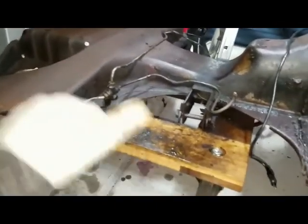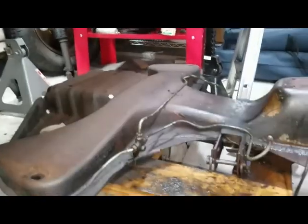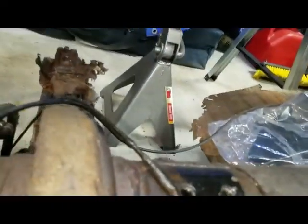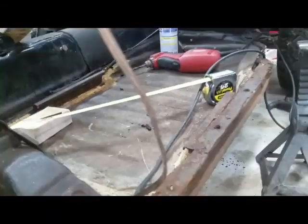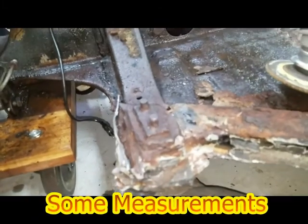I'm going to clean up this area — I think it's a little rusty but the metal is real solid. I'll clean that up and refinish it. But I'm worried about this front support and the floor pan. You can see the other floor panel is really shot. So I'm grinding it off to see where the spot welds are. Using the grinder shows me where the spot welds are at, and then I can use a small drill bit to drill those spot welds out. But I want to try to save this piece and see how bad it is — I'll film back in a couple of minutes.